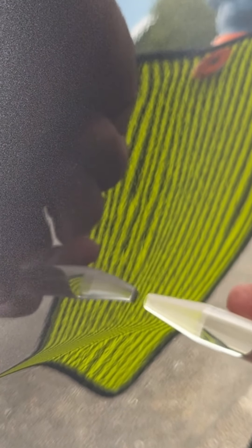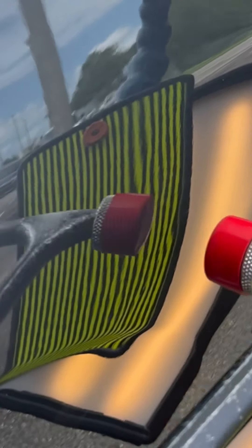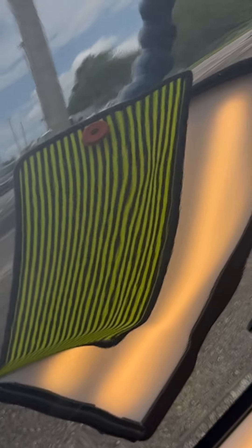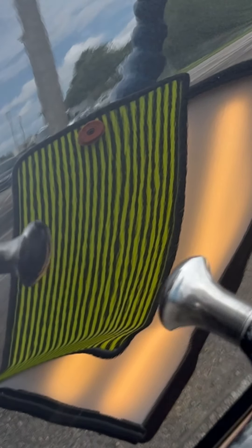The goal with this line board is to try to get all the lines uniform, and that's going to tell you that all of the metal is flat and back in shape. Now, I'm cheating a little — I'm trying to learn this line board, and the reason I'm using it is so that you can have a better idea of what's going on, because I feel like it's easier for a beginner to see. But it's harder for me to use, and I'm actually looking at my normal fog board behind it. I have the camera pointed at the line board for you, but I am trying to get better at it because it is more helpful in a lot of different situations.